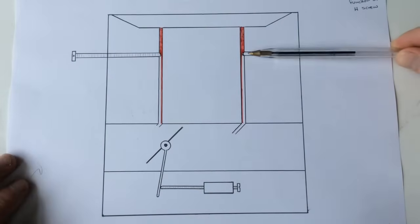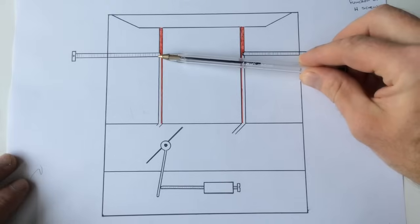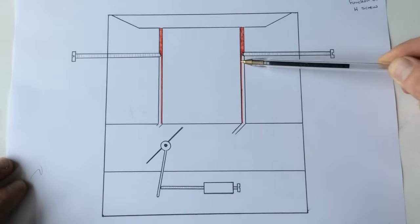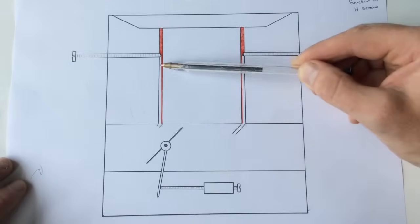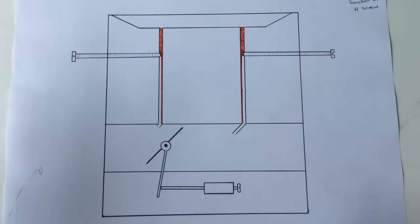Now what I've explained here is that we've opened each jet one full turn - the high jet one full turn and the low jet one full turn. It's opened up that gap slightly and now it's willing to accept fuel down both of these pipes. But remember, at this stage the machine still hasn't started.